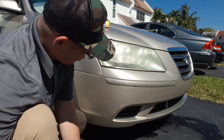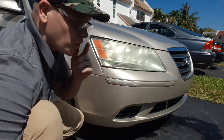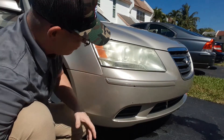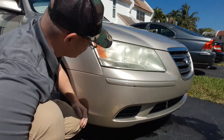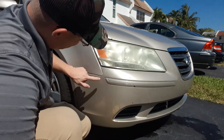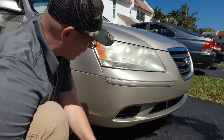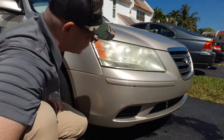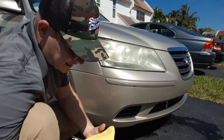We are mostly there as far as this one big area — that is so much better, just unbelievable. I'm going to leave it there — I know everyone wants to see the finished product, but from before to after, that big conglomerate area, that big spot right here, is all gone. What's left is what cannot be corrected — I have to touch it up with a touch-up pen or some paint touch-up. There are still some more areas to address. It's actually very easy to remove this stuff. I want to show you guys how rotaries are so easy to use and with just a little bit of caution you can get tremendous results — better results than a DA.